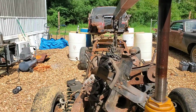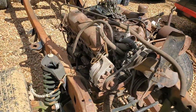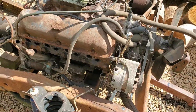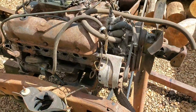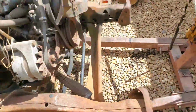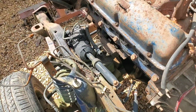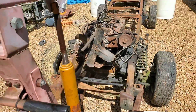If you look at the engine, it's got a slight lean to the right because, well, the left side's higher than the right side. Now, for all intents and purposes, one might say, who cares? It's in. Deal with it. Me? I don't know. I'm a bit of a stickler for fine details like that, so I would have to figure out what I could do exactly to level the thing off. I could either try to raise the right side up by adding something there, or take this bracket off and do some cutting and re-welding to make it sit lower relative to the right side, so our engine will be leveled off.